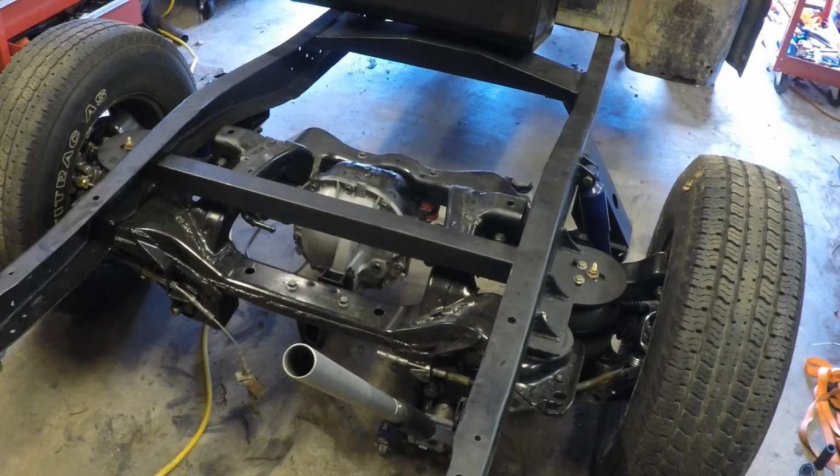In order to get the lugs out, I'm going to have to press the hubs back off the knuckles and pull them off the axles, all those goodies. I'm not really inclined to do that. So I think what I may do is basically bang them out till they're loose, put some red Loctite on them, and then draw them back in with a lug nut and a nut on the front. I'm not going to do it right now. I think next time I have the tires off, I'll tighten up those lugs in the hubs.